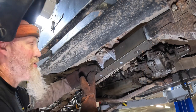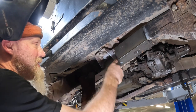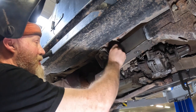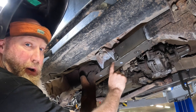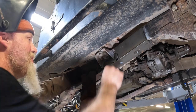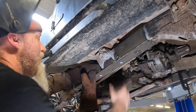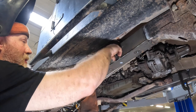Your other option, we do recommend at least going in and welding this inside before putting these in. But if you do put them in before, depending on how good you are, you may have to do a little bit of grinding on the bottom here. We got ours really close, flush up to the bottom of the frame. And this body mount, maybe a little bit low, who knows? Hard telling with the variation that you might see. But anyway, do what you have to do.